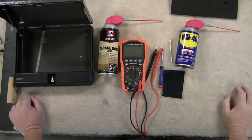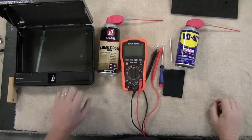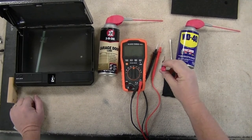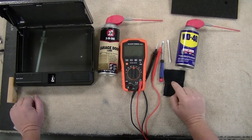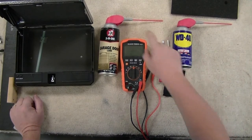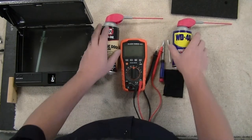You don't need a lot of stuff to do this troubleshooting. You need a digital multimeter because we're going to take a reading on the 9-volt to make sure our battery is good. You need a small Phillips head screwdriver — this is a number one. I use a cotton swab, a cloth rag, some sort of cleaner water dispersant — this is not a lubricant — and then some sort of lubricant. Use the lubricant of your choice; this is just what I have on hand.